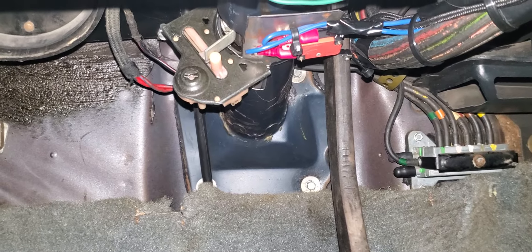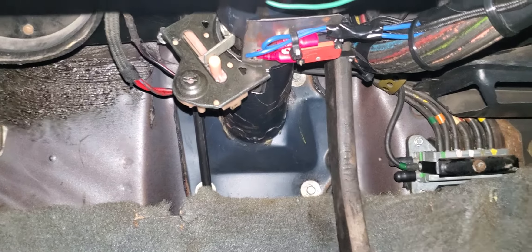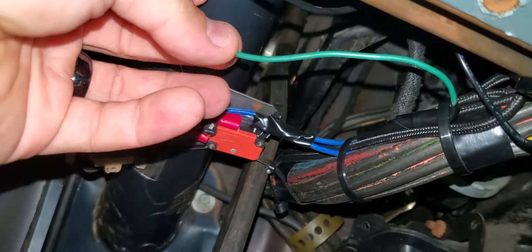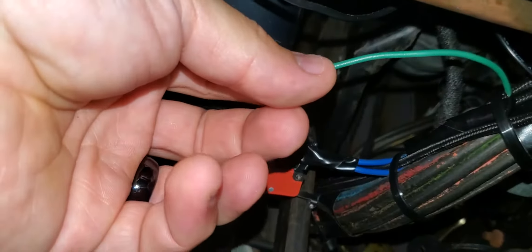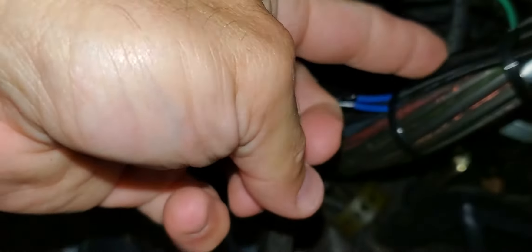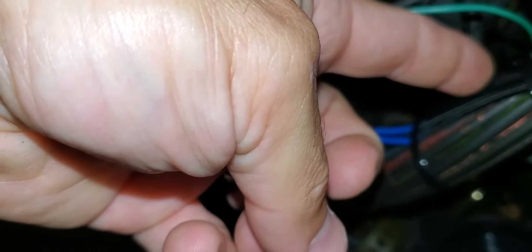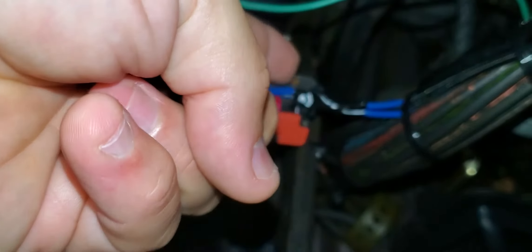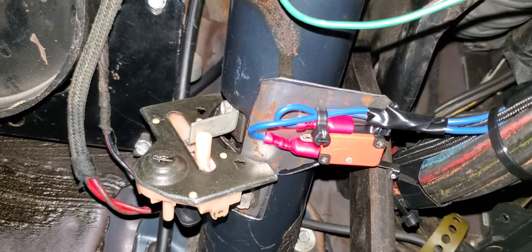This way I can put on my brake lights before I really get into any sort of braking. All I had to do was fab up a little adapter because I didn't want to modify any of the factory wiring. This green wire here that goes into the column is actually the signal wire for the brake lights — when you put 12 volts to that wire it turns on your brake lights, and you retain your factory brake lights wiring harness. So I just have a bullet connector into a regular style bullet connector, taped up, and then adapted to blade connectors for the micro switch.